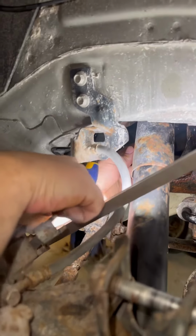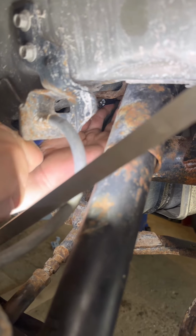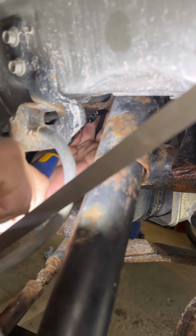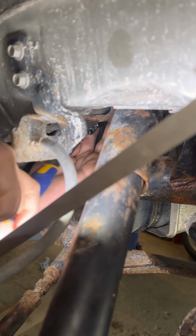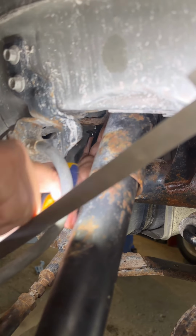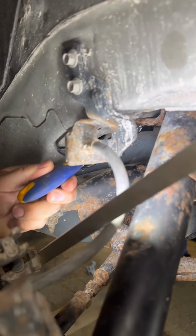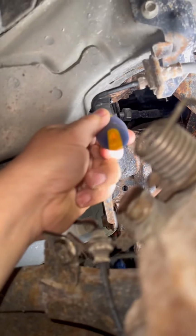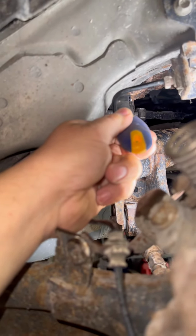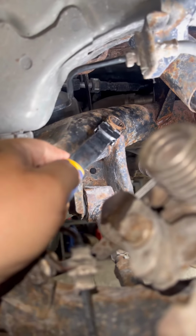All right, this bolt over here, we could just use an extender straight up and down. This one's our problem child, and the cradle is directly above it. Can't get a 1/2-inch ratchet up in there, but this swivel head allows us to get it right here. And we can get this bolt out in this tight of an area. What? No way. Pretty neat. Pretty cool. Yeah, it's a pretty tight area.